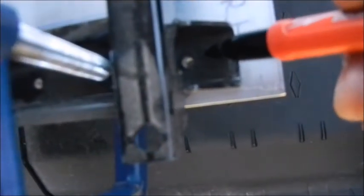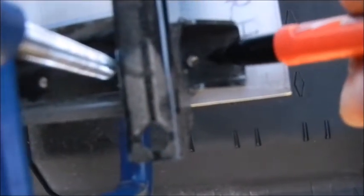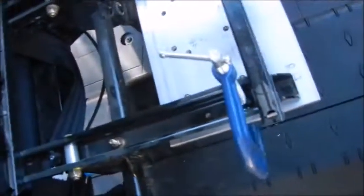The other pre-drilled holes are at the front of the seat frame on each side. The angle on those isn't straight in — as you can see, you can't really see the hole from above. So what I did was come in from the side, used a fine-tip marker, and put a dot in the center of that hole. Then I removed the plate and drilled it — I have a drill press which I used, but a regular drill will work as long as you get the hole drilled straight.